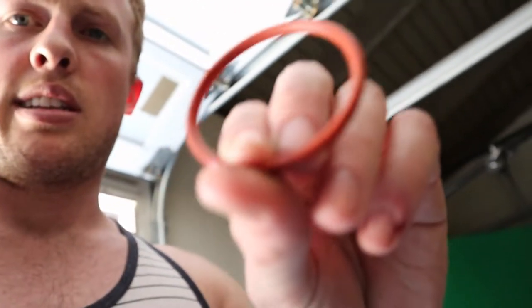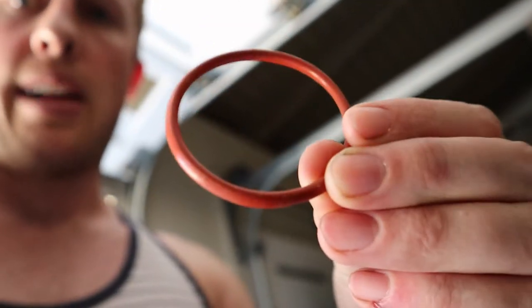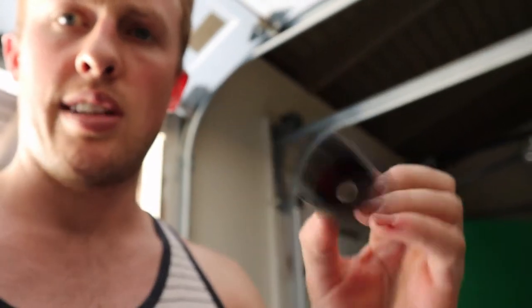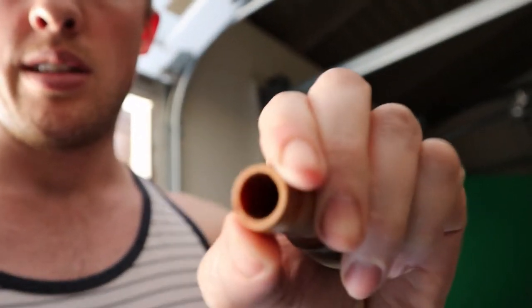The seal that came out is kind of flat, and so it doesn't seal — it doesn't hold coolant in there anymore. I took out the heater hose connectors and they look pretty brittle; looks like these are going to break soon, so those are going. This truck has about 140,000 miles on it, so it was time to do this stuff. I already did the water pump a while ago, so that's still okay.